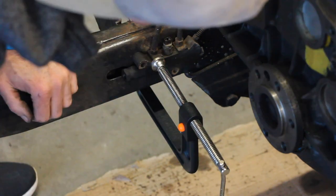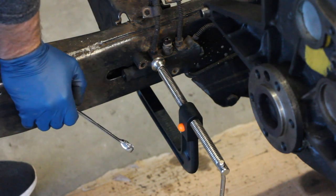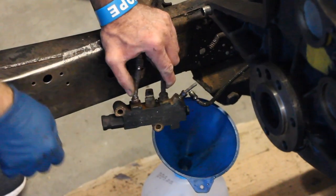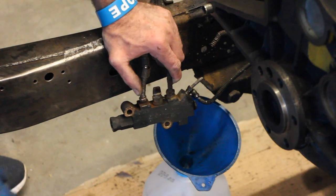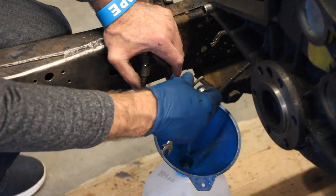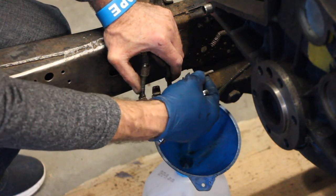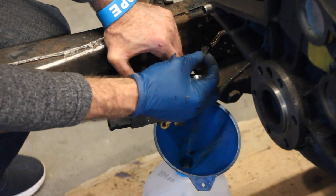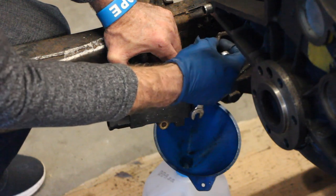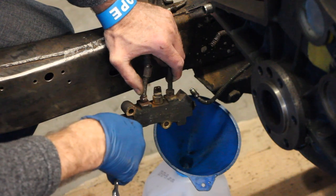Now this sucks. I'm going to be replacing these lines anyway. Some of you may be asking why I'm going to replace the brake lines on this thing. Well, like everything else, it's severely dilapidated — when I was unscrewing this nozzle, the brake line just snapped right through. That tells me there's not a lot of strength behind these things, there are a lot of weak points, and it was only a matter of time. That does not make me feel comfortable for stopping power.